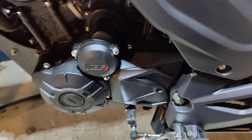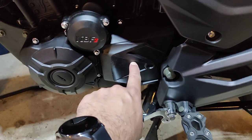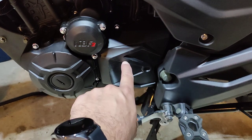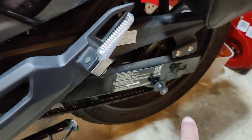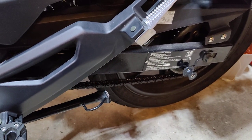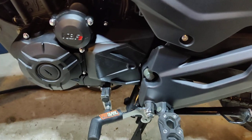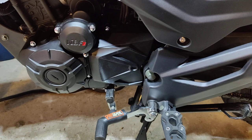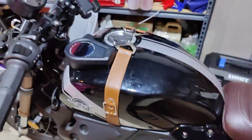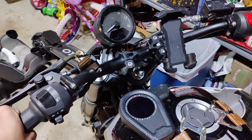What you can't see inside of here — this stock came with a 15-tooth gear, sort of a primary gear. Underneath this cover, the gear attached to the motor is right there. This came originally with a 15-tooth; I replaced it with a 17-tooth and just had to move the tire basically pretty much all the way forward. I still have a good amount of slack in the chain, but that definitely needs to be cleaned at some point. That was added aftermarket and it definitely improved the bike overall. It didn't really make it any faster, but the first, second, and third gears are much more usable now — I don't end up having to jump through all three gears almost within the first few seconds of taking off down the road.